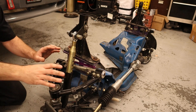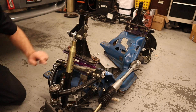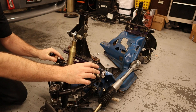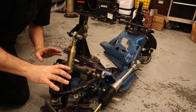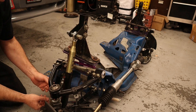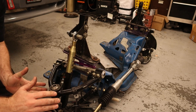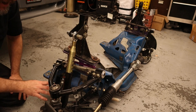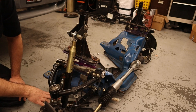To do caster — moving the suspension forward or back in the vertical plane — there are shims up in this upper arm with different hole placements so you can basically move this arm forward and back. That is the easiest way to adjust caster. I can also adjust the rear arm since it's threaded on both ends — just loosen the jam nuts and spin it in or out, which will push the lower portion of the arm forward or back for fine tuning.